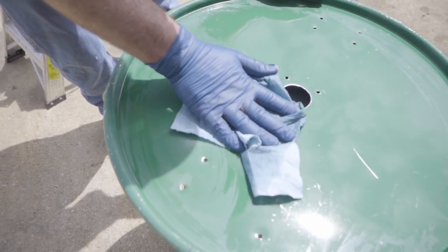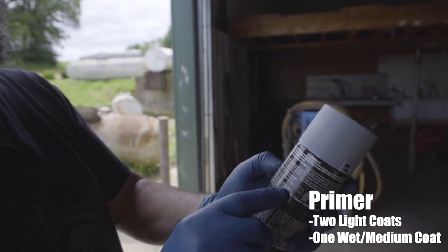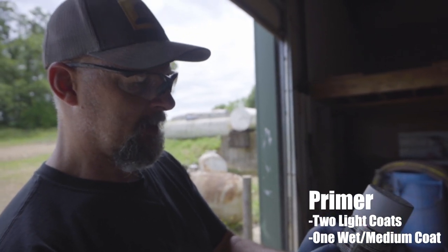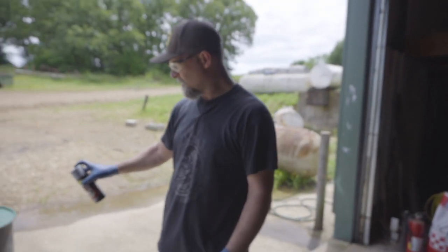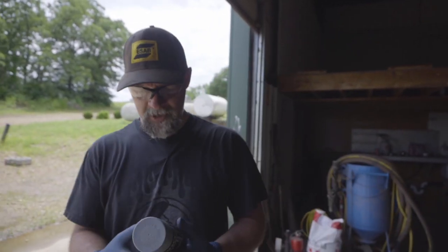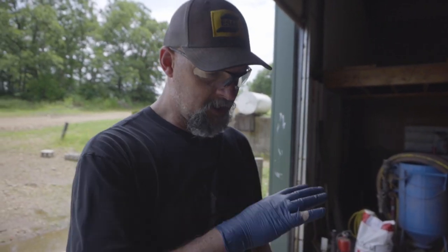This is why you need your kids to help, because they can shake this — they got the energy. We're going to apply two light coats followed by one medium wet coat. Allow 10 minutes between each coat and 30 minutes before wet sanding or applying the color. We're going to hold the can about 8 to 10 inches away. The way I do it is I go one coat, then I go the other way for the other coat — a guy told me one time that's called Body Man's Camouflage. You do that and then you do one good wet coat over it, and then we're going to walk away from it for 30 minutes.